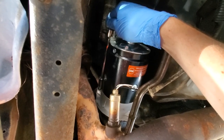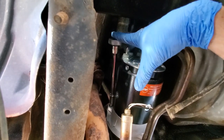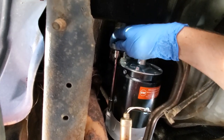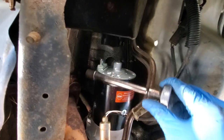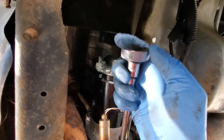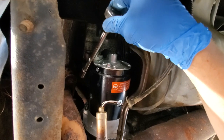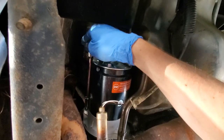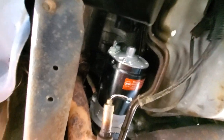I've got the upper bolt started and I wanted to give you a quick visual of what I used. I held the starter in place with my left hand. I've got the half inch socket on an extension and a handy little thumb turn ratchet — it gives you a good grip. I put the bolt in the socket before I got situated and was able to use the extension to position the bolt in the hole and start turning by hand. I've got it in far enough now that it's not going to come out, and now I can position the lower bolt easily.